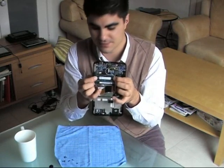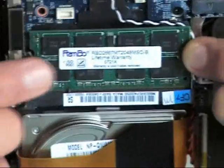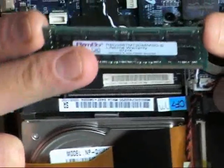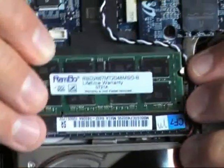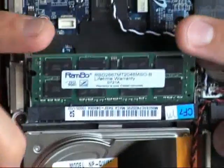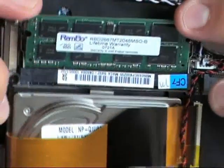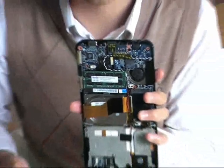There are two metal clips that sit inside and attach to the RAM itself. All you want to do is pull them slightly out on the left and right side of the RAM, and then you see the RAM comes out gently. Always pull RAM out parallel to the base of the RAM slot and put it back in the same way. Put a little bit of pressure on to the RAM itself at the left and right top corners, parallel to the base of the RAM slot, and it just pops back in without really much pressure at all. Then with one finger, slap it back towards the motherboard — those two clips do the rest of the work by themselves and just pop the device back into place. Your RAM is upgraded.